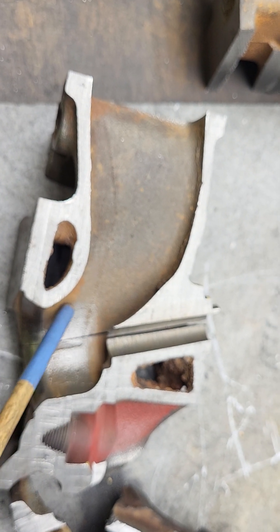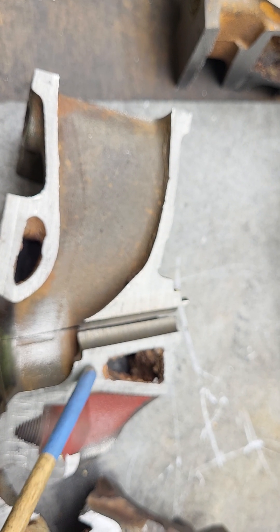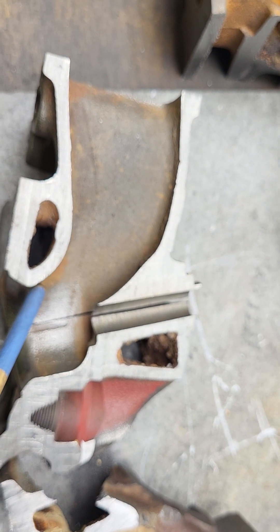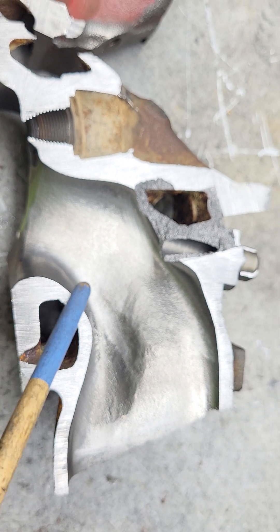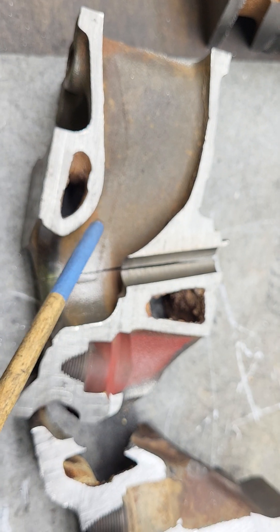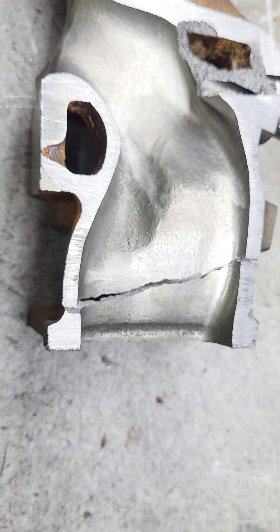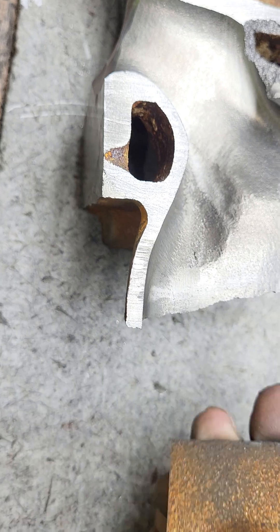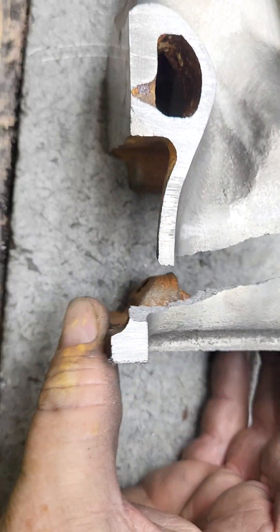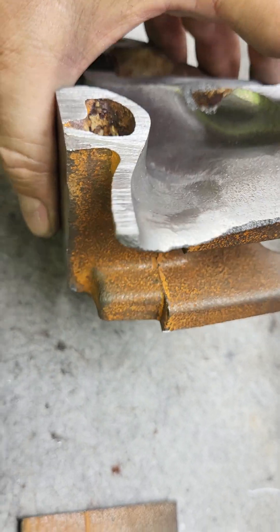This is the Dart — notice how much smaller the bowl is. This fin goes this way so the port comes like so. It would look a lot better if you ground that whole thing out, but the short side is not great. This Magnum has a much better design, much higher, while the Dart is quite low. I actually broke it at the pinch trying to get it out, but you can tell there's not a huge amount of metal there by the time I was done — we were trying to get some decent gains.